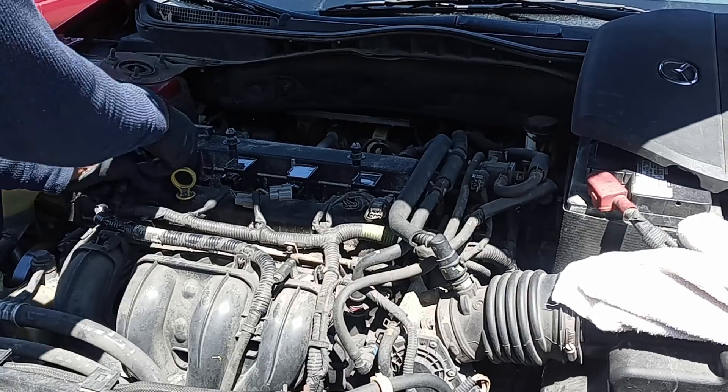I'm gonna check your fuse box for the fuel fuse. For this car, the fuel pump fuse will be 25 amps.